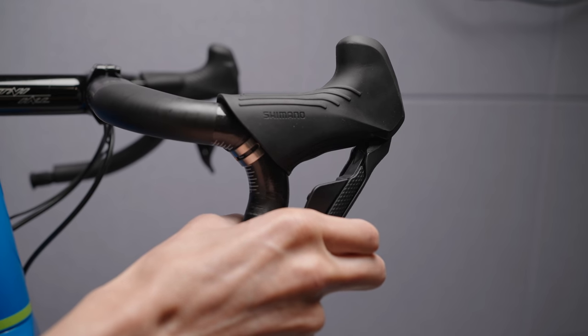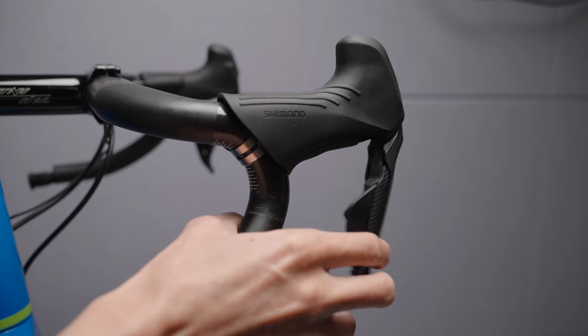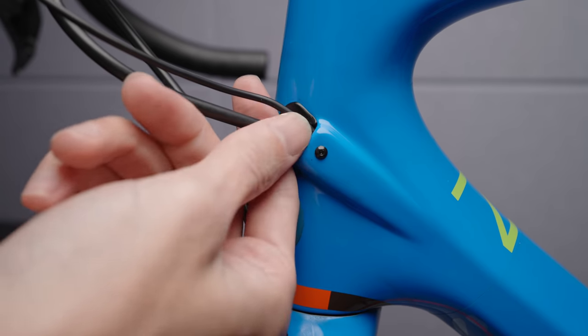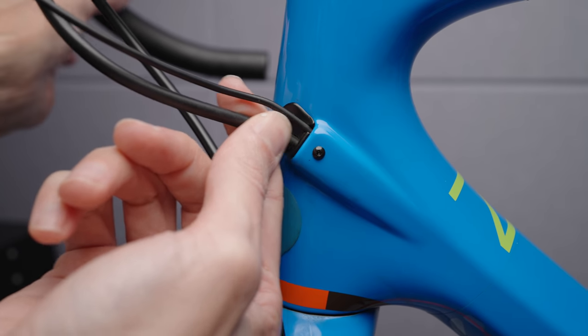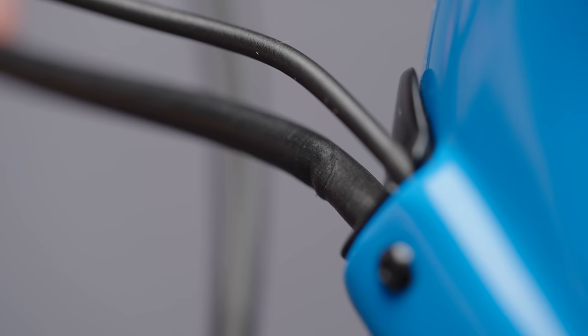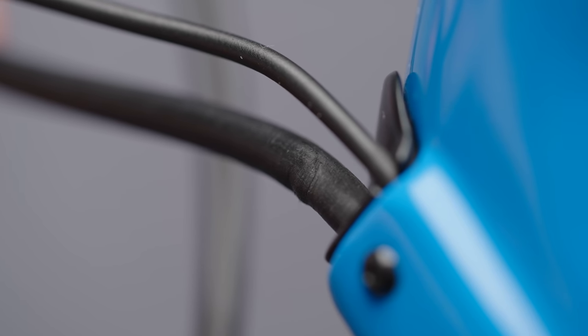You can also call it what it really is, and that is a kink in the brake hose. In my case that happened at the frame hose port. As I squeeze the brake and hold my finger on the kink I can actually feel the hose give once the pressure builds up enough. And if I get really close with a macro lens on the camera you can even see the growing bulge.